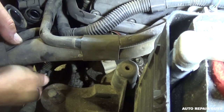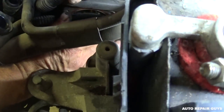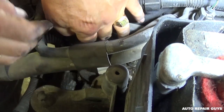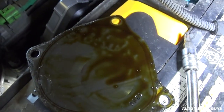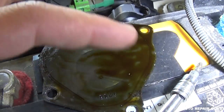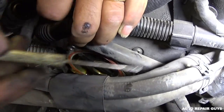There is an O-ring — that definitely looks like where the leak started developing. Need to lift it up and pull it out to see what's causing it. You can see that's the O-ring right here — that's what's causing our leak. You can see it's not sealing, and that's the cap, the lid right here. So that's definitely what was causing our leak. You need to get a new gasket for that — it's not even really an O-ring, it's kind of O-shaped but it's a special gasket for that component.